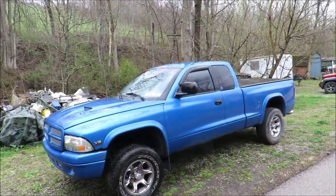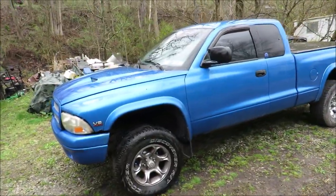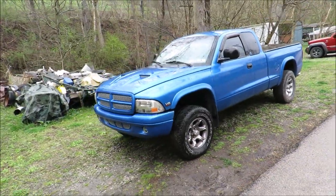Super happy with how the brakes came out. Hopefully they perform well and hopefully that paint holds up. It did call for a cure time — you almost have to bake them — but I heard from other people that if you just drive it for about half an hour and stay heavy on the brakes, the heat from the brakes will actually cure that paint. I'm going to wait for the rain to pass and do that tomorrow. Let me know what you think, leave a like if you enjoyed this video, drop a comment, and we'll catch you in the next one — always accelerate and don't look back, see you next time.